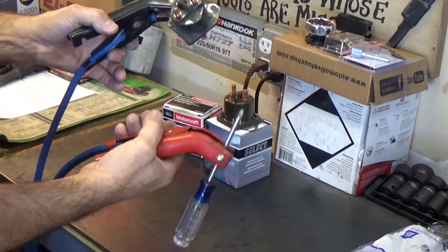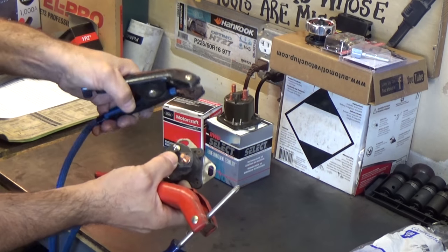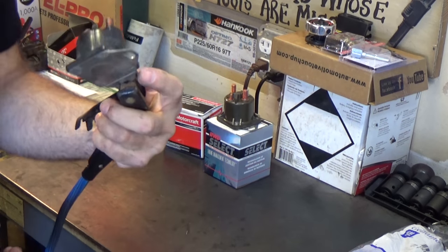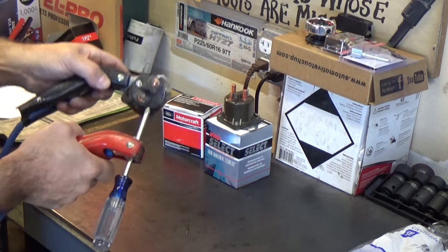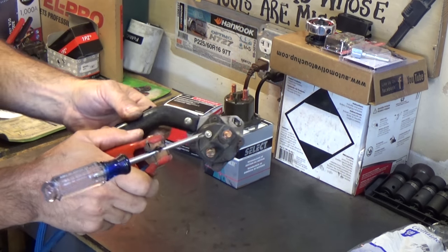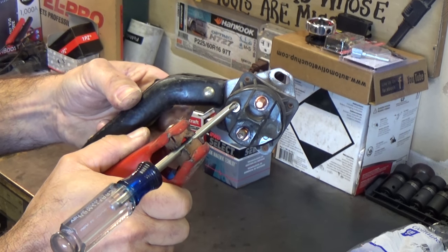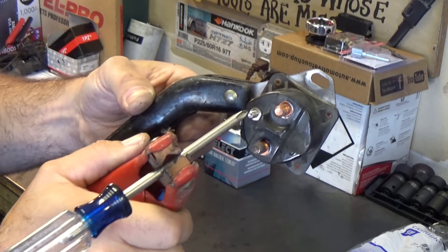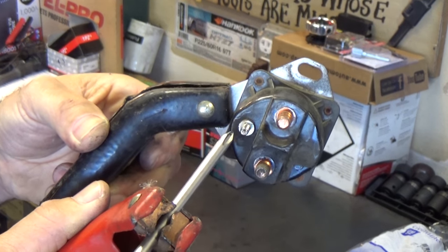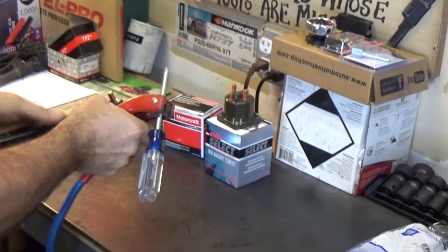Here's the original — let's go over to the bench and play with this thing for a minute. I have my 12-volt source: a spare battery with some jumper cables. I took the negative clamp to the back plate here, which I showed you is ground. All we need to do is touch the signal wire — when we do, we should hear this solenoid click. This one's been intermittent, so maybe it'll work, maybe it won't. Okay, can you hear that? This one's working at the moment. But it's been weak — it's starting to go bad.